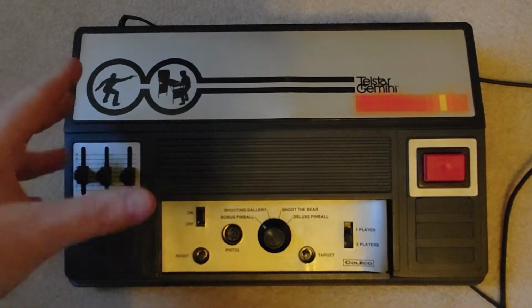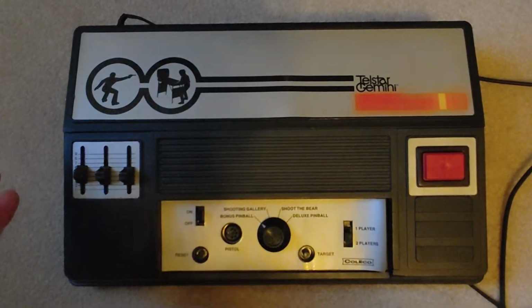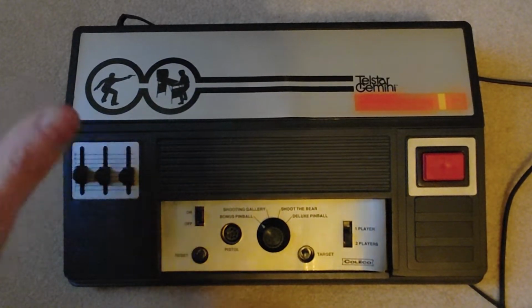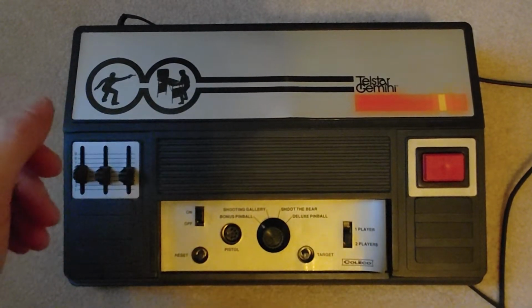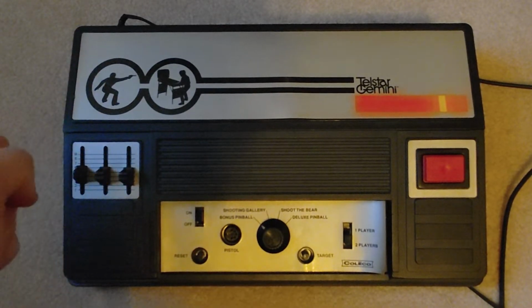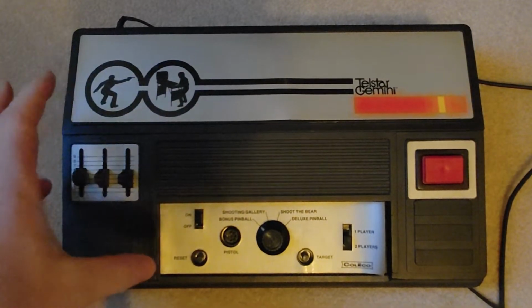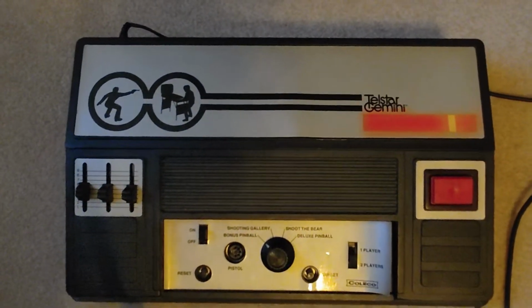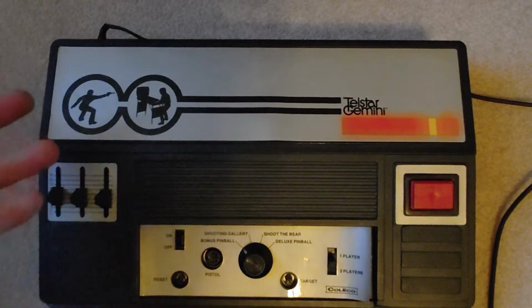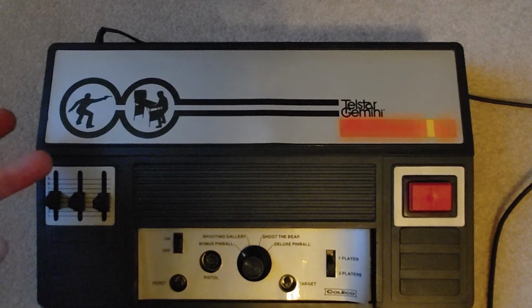I've already plugged this one in because making a whole video about something that completely doesn't work, like our Pong system, would not be that interesting, especially in the early days. But some of these other ones I definitely will just plug in and we'll see if it sparks and catches fire. Didn't want to make something that was just completely a letdown, though. This one does work, but the thing about a lot of these old systems is they're not recapped. I didn't go through and put new capacitors in place. You're talking about capacitors that are 40 to 50 years old, and realistically, they're just not going to be in great shape.